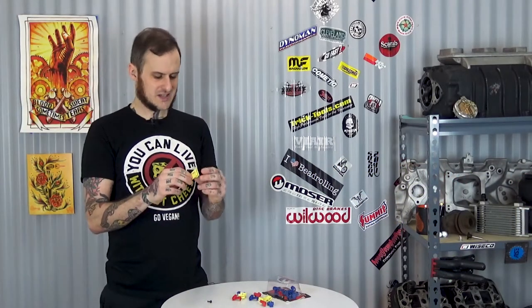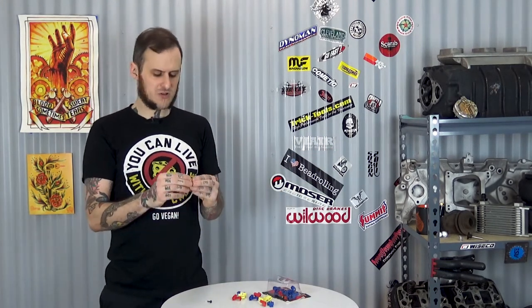So when it comes to these things, there's a lot of problems with them. Quite simply, they're just breeding grounds for corrosion and they're breeding grounds for resistance in wires. The problem is that these cutters in here, say this yellow one that I have here, is rated for like 10 gauge wire. Yellow is generally around 10, 12 gauge wire. Well, the slots in there are very small.